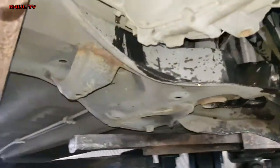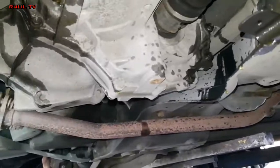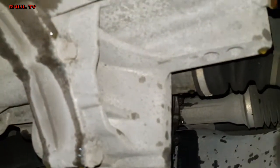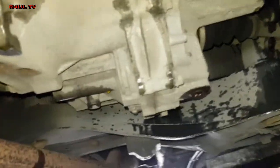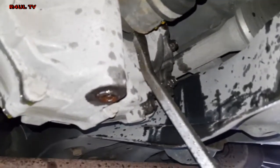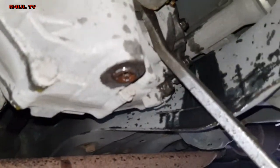Same on this side as well. There is a centre stabilizer mounting up there but that doesn't matter — we'll get to that after. We're gonna take the bellhousing bolts off, take this pipe out of the way, and go from there. That pipe is to one side — I don't need to take the full pipe off because the radiator side is stuck solid; you don't want to snap the neck of the radiator. Before we take the drive shafts off completely — drain plug is right here. Drain the gear oil first. The filler plug is up there. Let's drain the oil.